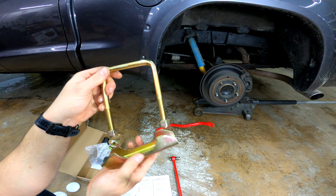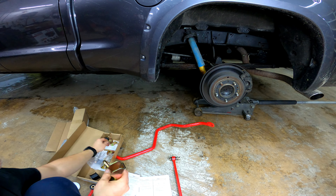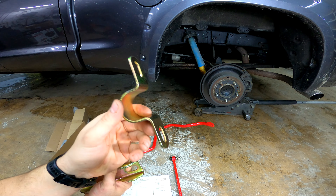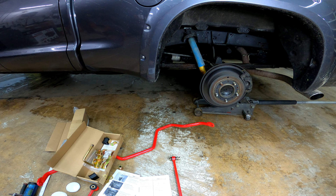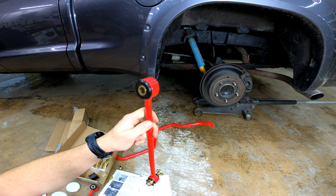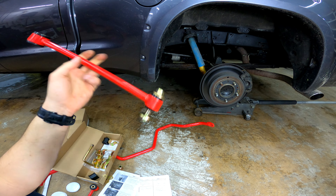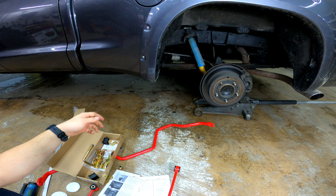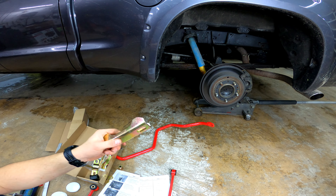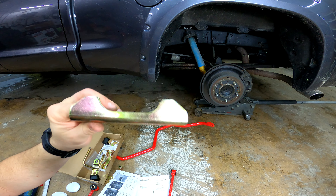You remove the lock washers and then put this in — it kind of clamps everything together. Don't forget the piece that actually holds that bushing; that goes in there too. Now the important part: torque. The end link to the frame — this top larger M14 bolt to the frame — is 84 foot-pounds. End link to the rear sway bar is 48 foot-pounds. And then you alternate tightening the U-bolts, which are also 48 foot-pounds. You don't want to over-tighten these because it'll bend this and you could snap the nuts off.